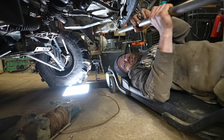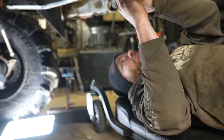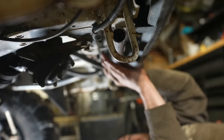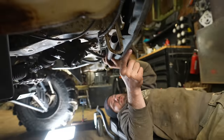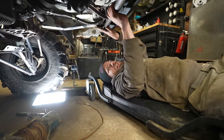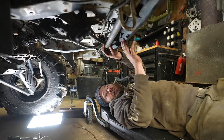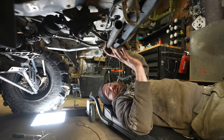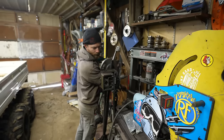While we're waiting for parts to show up, I'll go ahead and build a skid plate, and sort of a subframe thingy up here. So I'm thinking I'm gonna put a bar, a tube across here between these two tow points, because they're very strong and solid to weld to, which will also protect all the wiring and all of that kind of stuff. But it'll still hide behind the stock bumper. And I thought about building like a metal bumper or something, but I kind of like it looking like a totally factory Mitsubishi minicab.